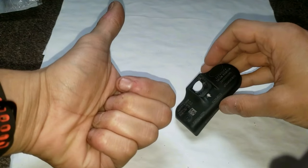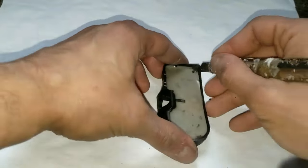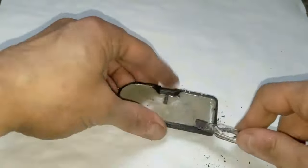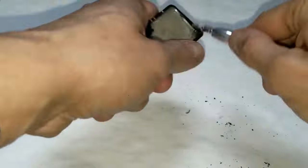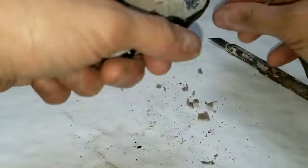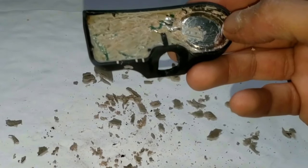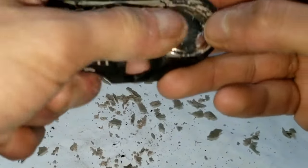Let's get ready to tear this apart and get that battery out. I'm going to use a combination of pointed tips and some cutting knives. Be very careful if you do this because you have a very high chance of cutting yourself — I am striking the blade away from myself. I'm trying to remove this silicone piece by piece; very tedious. You can now see a piece of the battery. The battery doesn't have much silicone on it now, and there is some silicone on the left, which is where the circuit board and chips are.